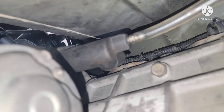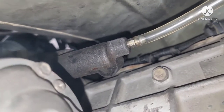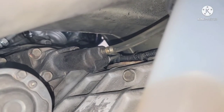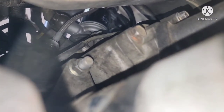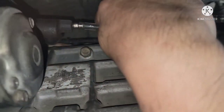It's been bled. I probably emptied about one and a half containers, pumped the clutch pedal 10 to 20 times, and it's getting nice and firm. I closed the valve — it's really good now, nice and firm. There's the slave cylinder right there; you can't even see the plunger inside. This is inside the transmission — there's a little window there. I can pull out this bleeder kit; it's ready to go.